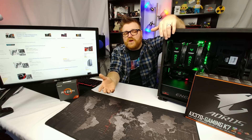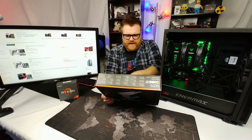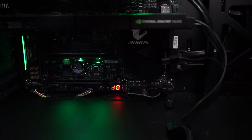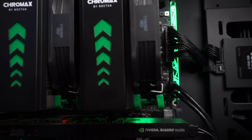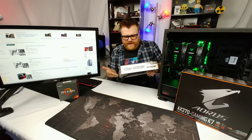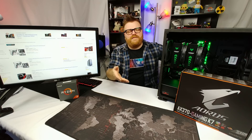It has really good audio — external caps and that sort of thing — that make it Sound Blaster quality onboard audio. It has nice lights all over it, eight fan hookups with pump support. A couple of downsides though: it only has one NVMe slot and one M.2 slot in total, whereas even this board has two M.2 slots — only one of them being for NVMe drives, but you could plug a SATA stick in one and an NVMe in the other.